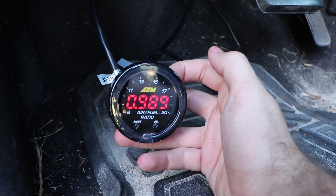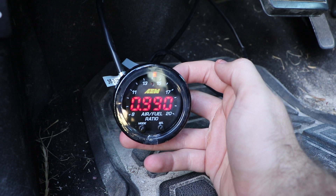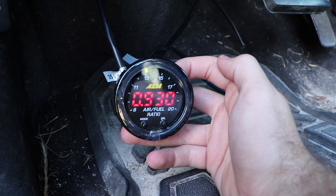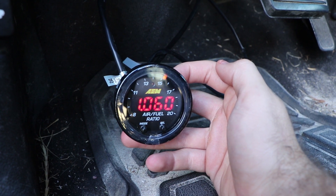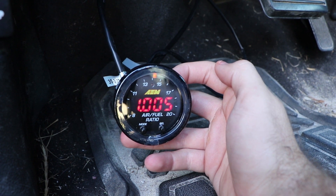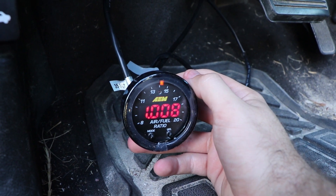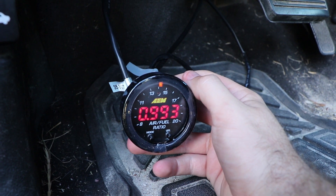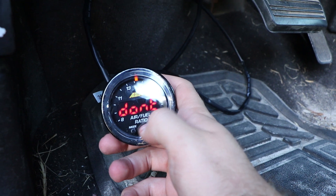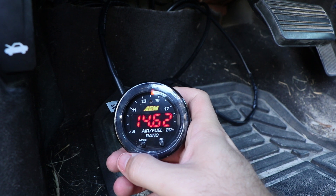Now I do have the truck running, and as you notice, it's not in regular air to fuel ratio — I actually have it in lambda. One is stoichiometric, anything under that is rich, and anything above that is lean. The reason I have it in lambda is because it's easier to read for me, and also depending on which type of fuel I use — sometimes I run E85, sometimes 93 octane — it doesn't really matter. It's going to read lambda, and one is stoichiometric if it's calibrated correctly. Now it's really easy to switch it over to air to fuel ratio: all you do is click mode and select, and now you're running air to fuel ratio and it'll read as that.